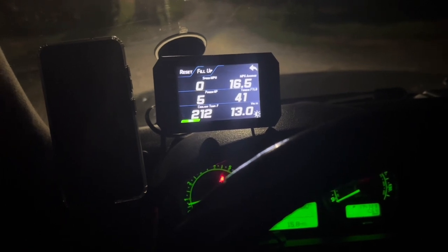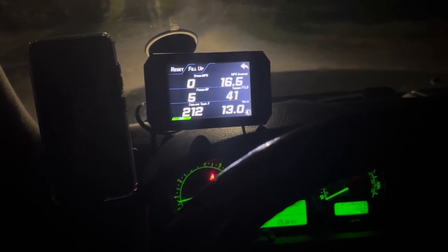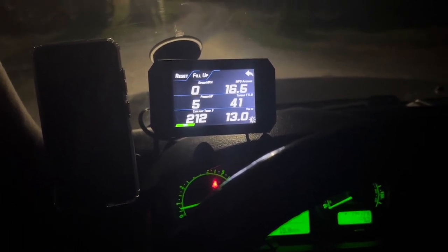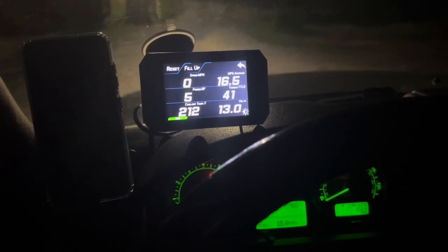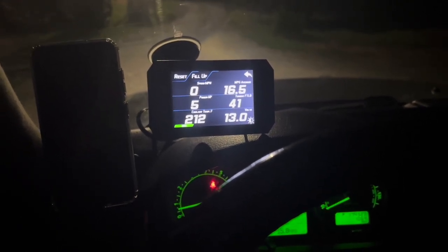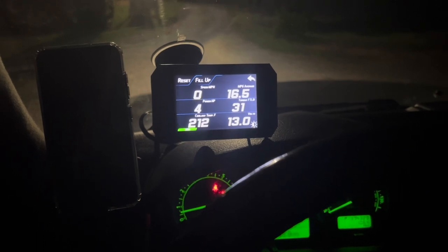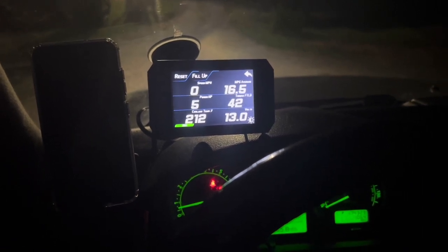Now you might be wondering, why didn't I replace the radiator right away and do everything correctly right away? The answer is, it was summertime and it was already hot as it is. And I noticed with my temperature gauge, when I was monitoring everything with this external gauge, that I was within range for operating this vehicle. It's supposed to be 195 Fahrenheit to 220 Fahrenheit. That's a normal operating range, and I was within range. So I decided it's actually not bad to have the thermostat off, and instead things will be a little bit cooler at a constant, versus cooling down and heating up, especially in the summertime and when you get stuck in traffic.